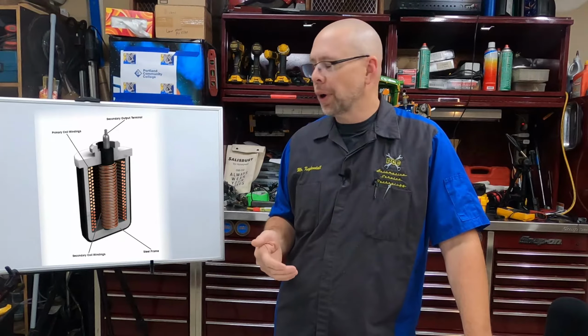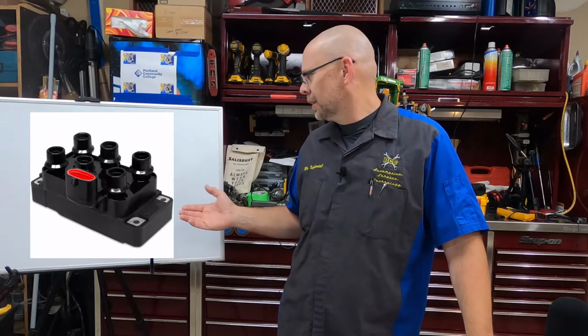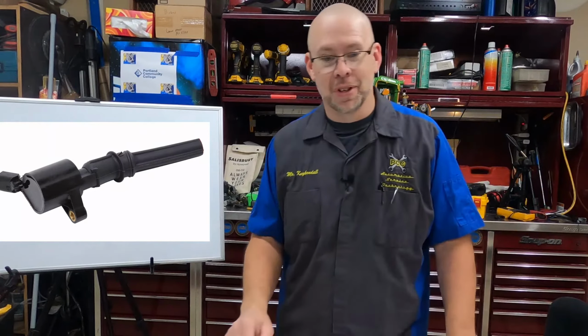Now, we have different packaging for them. We have an old school coil. We've got an HEI coil. We've got what we termed an E-coil. Then, of course, there's DIS and COP coils. Not that kind of COP. Coil on plug, COP. More of our acronyms. By the way, you will find a term sheet on D2L.